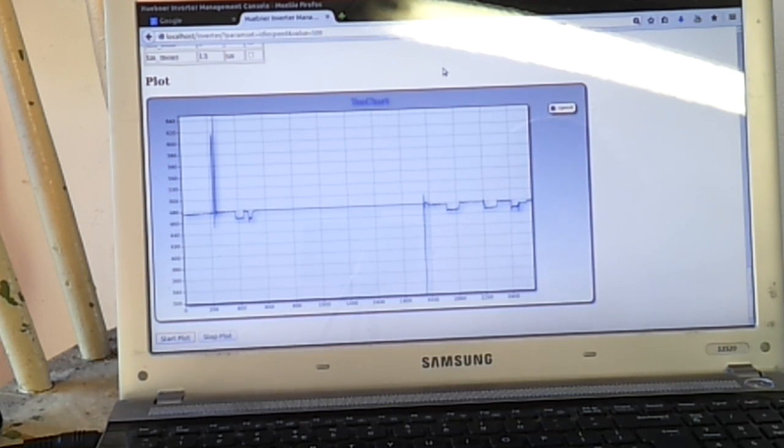Very interesting to see how the RPM graph varies depending on which gear. Third engaged. My code for fourth gear leaves a lot to be desired — there's a bit of a dip in the revs; I'm probably not getting the pre-fill on the fourth gear clutch pack quite right. That needs some work. And let's throw it into fifth — bit of a dip going in, but we're running in fifth gear now.